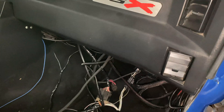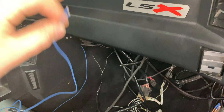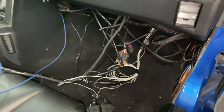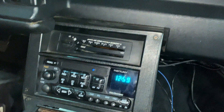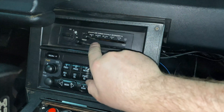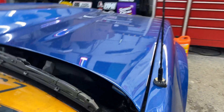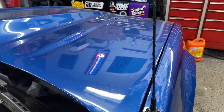This has to stay a mess for now because I have to run the wire for the pulse width to one of the injectors. This is for my new meth controller — I'm not using boost reference anymore, so I've got to figure out which wire in the Holley loom I need to tap into before it actually gets tuned. We turn the ignition on, fans come on, you can hear the compressor click, and everything works as it's supposed to.